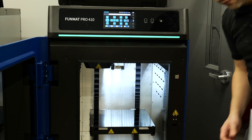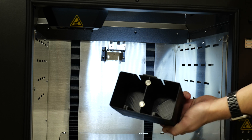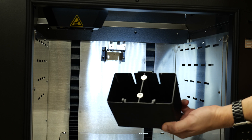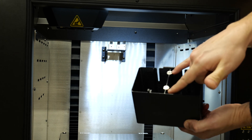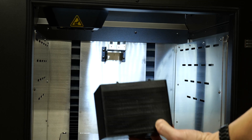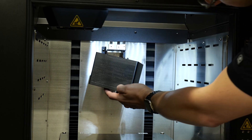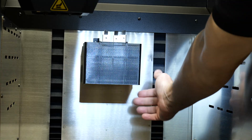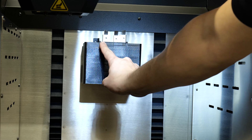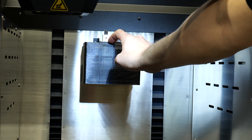The junk box looks like this — if you can't find yours, it's inside your filament drawer wrapped in bubble wrap. There are two little magnets and there are magnets on the other side. This just slides up underneath and there are two little grooves for the sides of the bracket. It's not quite flush against the back, but the front of it should be in line with this, and then the magnets hold it onto the metal plate. This will catch all the little goobers that get knocked off the nozzles from those brushes.